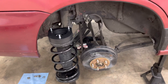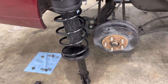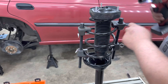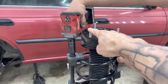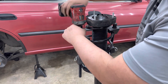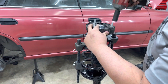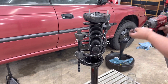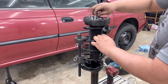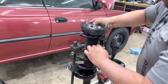Like you saw previously, we installed the rears, but now we pulled them back out to add these spacers right here. Paul and I are going to walk you through a little bit of how to do this the safer way — and that is with a spring compressor. He's already got the spring compressor hooked up to it. We've got to pull it apart in order to pull these out and hammer those out to put the spacers in. You want to make sure you're doing this the safe way, not just taking that nut off and expecting it not to shoot across the room — because that will happen. You can look up YouTube videos of that happening.